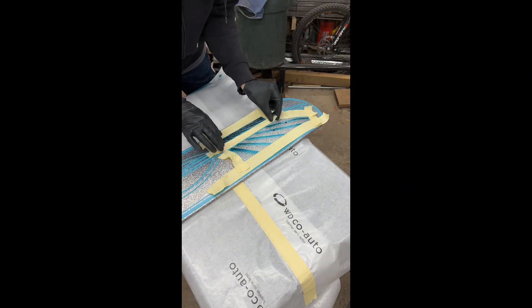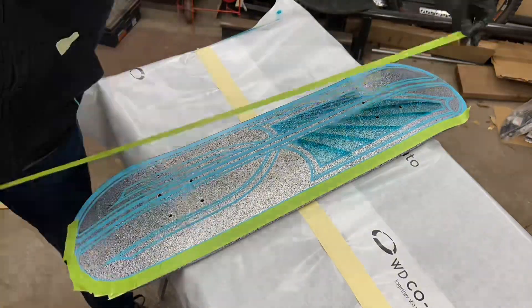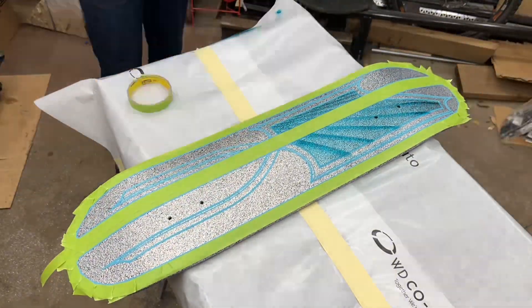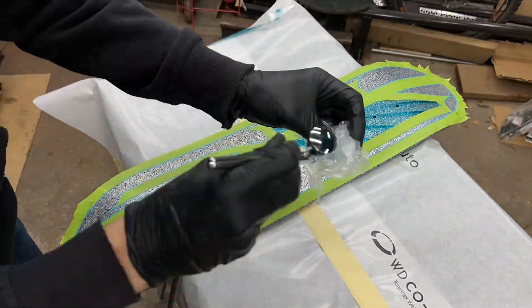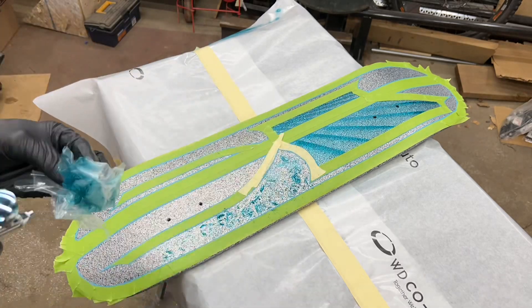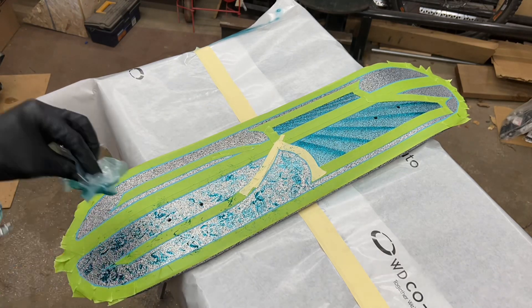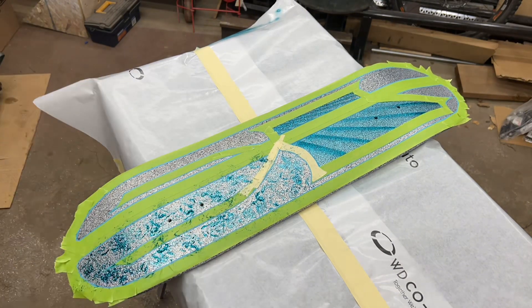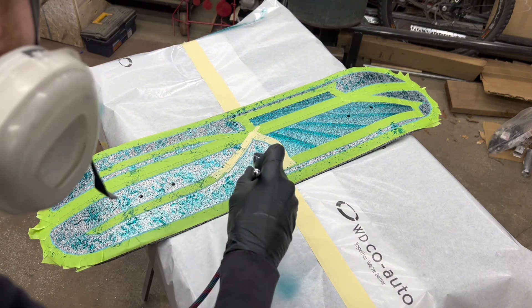Here I am masking off the perimeter of that section, and I realized after I did this that I could have just done this to start with, because I ended up masking off the whole second section anyway. The reason I did this is just so I'm not laying that candy over the other areas where I'm going to lay a different color candy afterwards. And I'm just using a plastic bag here to dab that in, just to give a little bit more effect — it gets nice and thick in some areas. Then I'll go over it with the airbrush after to darken up the whole thing.